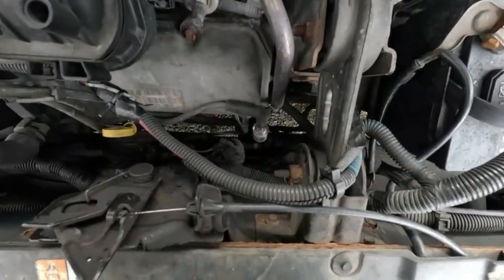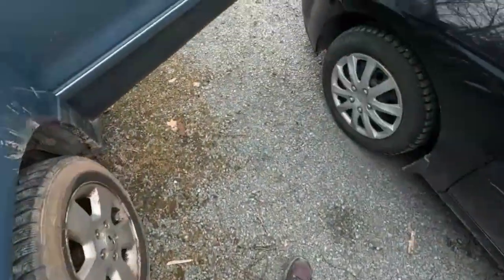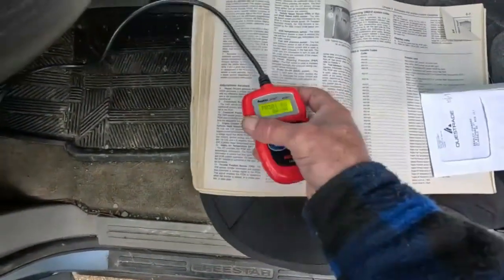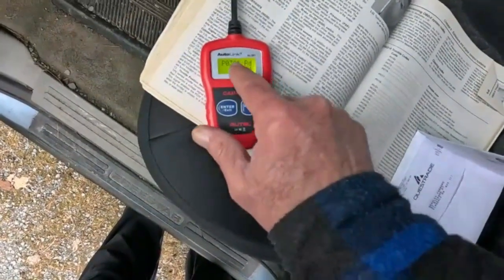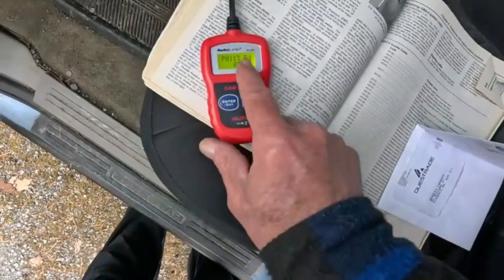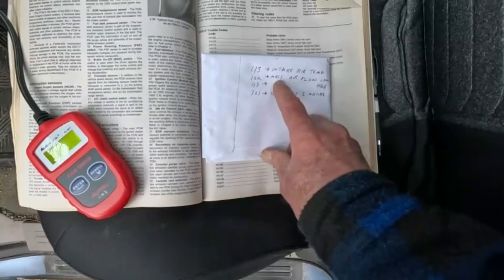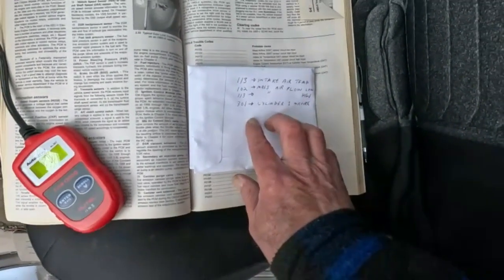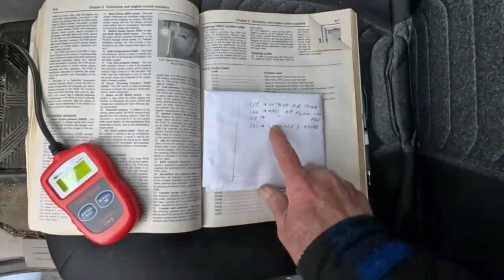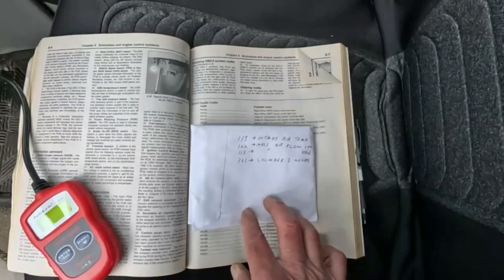I want to show you something if you're troubleshooting: I took the van for a test drive with the spark plug tester still on, then I reset the engine codes before the drive. Coming back and reading the codes, we have four codes: P301, P113, P102, and P113 again. The mass airflow indications are probably due to the misfiring cylinder. The P301 cylinder one misfire is still present, but we do not have a code for the cylinder we had the spark plug tester on — because even with the tester on, that cylinder is firing correctly.